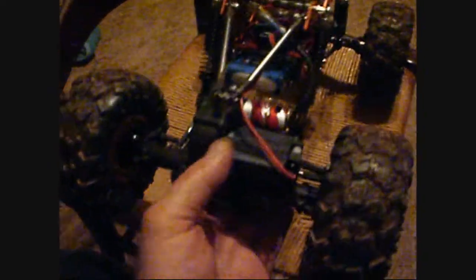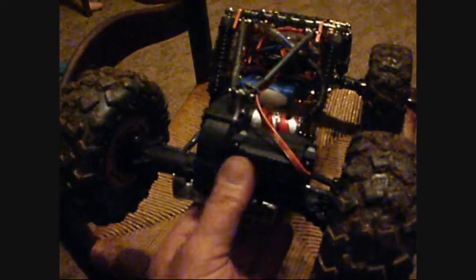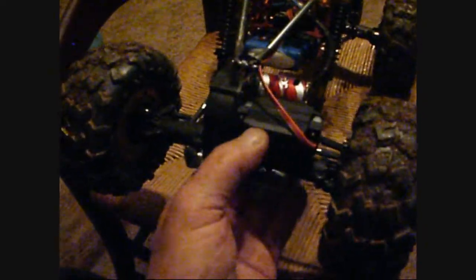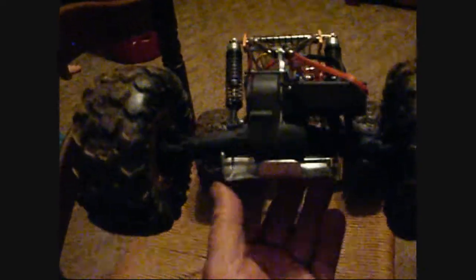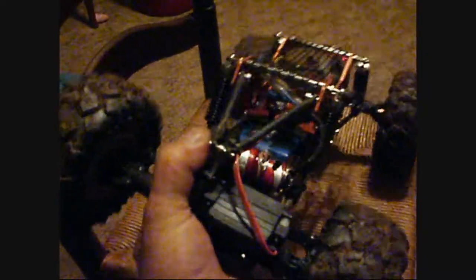And then I found out that the Lansu stock factory Red Cat's servo has a bearing in it that fits the output shaft of the Axial AS3 servo I've got here, so that's cool. So I fitted that in there, and I'm going to redesign this skid plate. It pretty much sucks. This design is horrible. I'm going to take that off in a little bit. I'm just tired of tinkering for right now, for a few minutes.